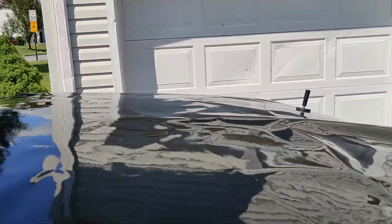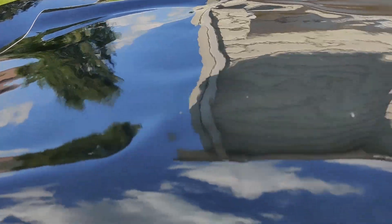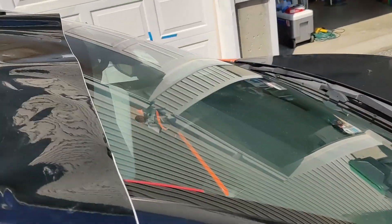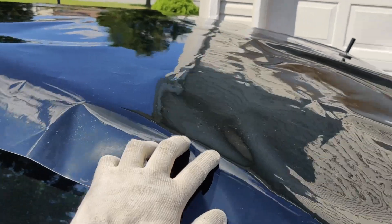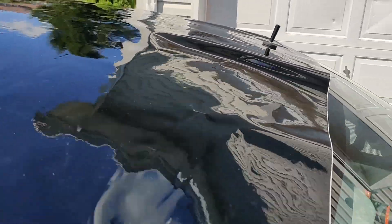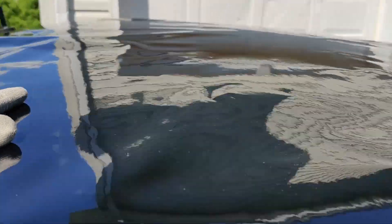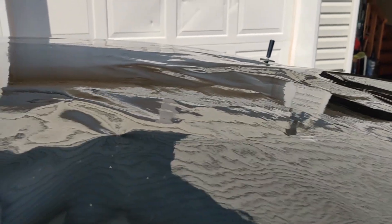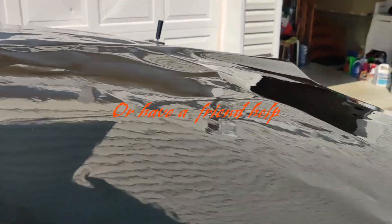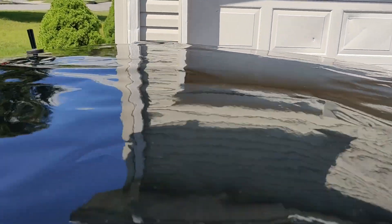I'm laying out the vinyl and using two magnets to hold the other side. I'm doing this side first because it's the hotter side facing the sun. You can see the vinyl barely goes over the roof — this is a five-foot by four-foot piece. I used a five-by-four piece before but I like it a little bigger so you have some extra room to play with. I lay it out around halfway, then cut the backing off and stretch one side out first.